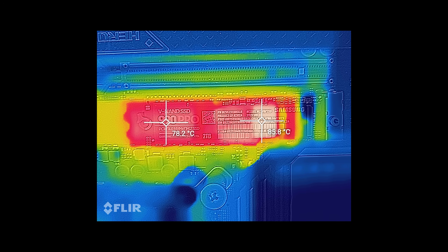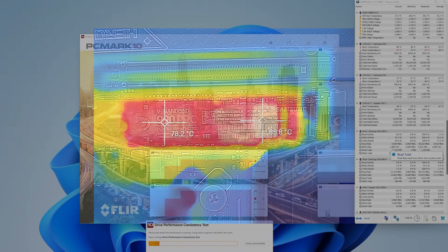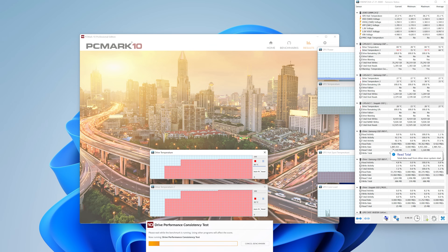Now let's see how hot it gets. Samsung's own specs say the drive should ideally operate between 0 and 70 degrees, but without a heatsink or fan this SSD can definitely get much hotter under stress. Looking at the thermal camera I saw an outside temperature of around 86 degrees, at which point it started throttling with internal sensors already reporting 99 degrees. A heatsink is an absolute must for this drive. If your motherboard has one, you'll be fine; if not, grab the heatsink version from Samsung, or a third-party heatsink for about ten dollars.